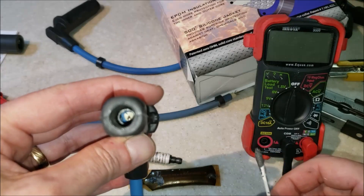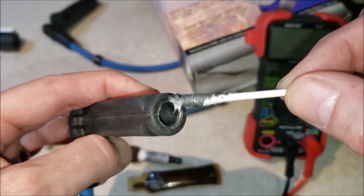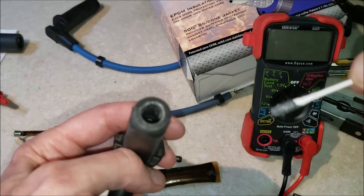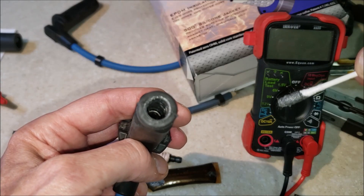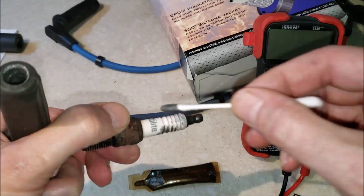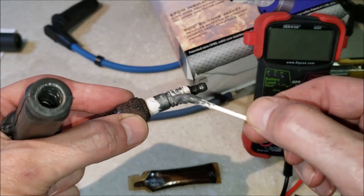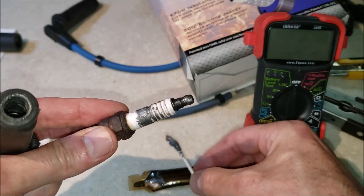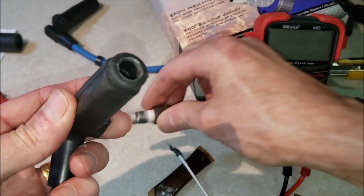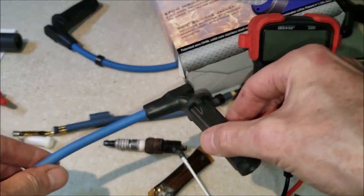Here's my process. I've got my spark plug boot here and my dielectric grease. I get a little bit on my Q-tip and just put it right down inside the boot. Don't go crazy with it because we don't want to get any on the electrical connection — keep that metal piece dry. You can also apply some directly to the spark plug ceramic — one of my old spark plugs here — because that'll help prevent sticking and also prevent any current from jumping down to the ground of the spark plug. And later on when you need to get it apart, it'll come apart easy without sticking to the ceramic.